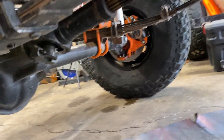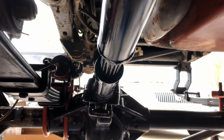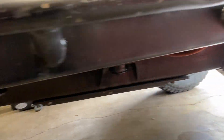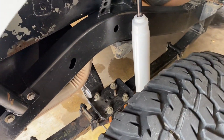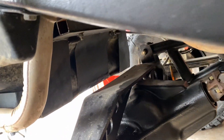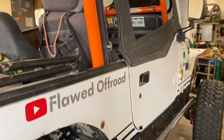The next thing I need to do is get under here and just re-torque everything - U-bolts, the driveshaft bolts. I've probably put five or six hundred miles on this thing and two wheeling trips, and there's a lot of stuff I need to go around and check the torque on, make sure things are staying together and that no jam nuts are coming loose. I also made some bump stop extensions up front but never got around to making them for the rear. I was worried about the axle and the truss coming up and hitting the fuel tank, which as you can see I modified quite a bit to get some extra clearance. But so far it hasn't even rubbed, so for now I'm just going to leave it until it becomes a problem.